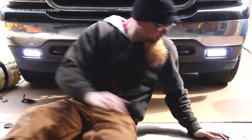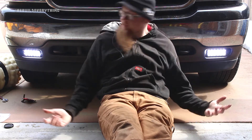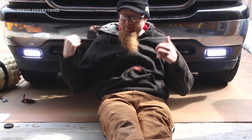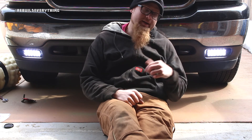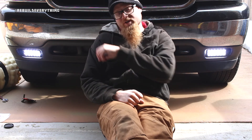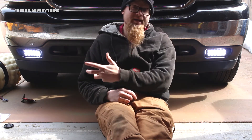Overall, I'm going to sit down here in the middle and talk about a couple things. I was super glad that went simple. I should probably refine those brackets a little bit — undo the wiring on this side, clean them up, hit them with a slightly better coat of paint since they rusted pretty quick. I'll re-dielectric the working side and re-plug it back in. I'm going to go back to the stock fog lights and grab those weather pack connectors. You could grab a set from the junkyard off pretty much any GM vehicle with auxiliary lights — just a two-prong connector. Wire these existing wires into it to give it a more permanent weather-tight connection. Or just leave it packed with dielectric and electrical tape. Since these are going to be on here for a while using the factory switch, there's no reason not to use a factory-style plug.